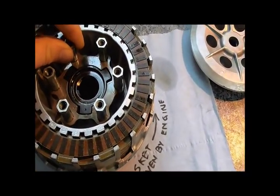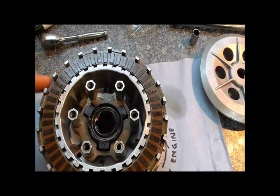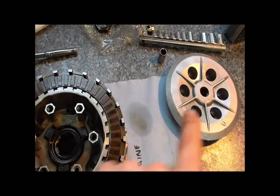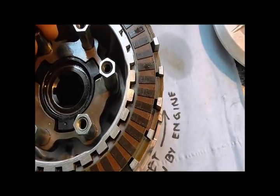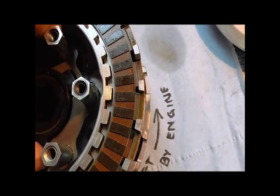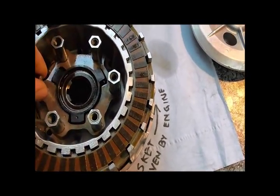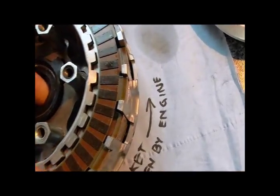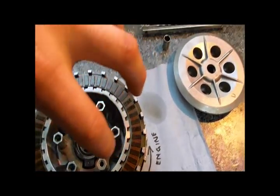It's when this outer ring is twisted through the clutch plates. Remember this is turning anti-clockwise, which turns this anti-clockwise, which turns that anti-clockwise. Those bolts go through here and locate on that, so that will want to turn anti-clockwise. When that does so it will want to ride up the ramps. It's difficult to do without it all being attached, but that will basically turn anti-clockwise relative to this part here and will make it screw down.